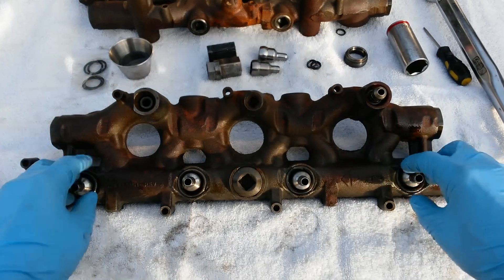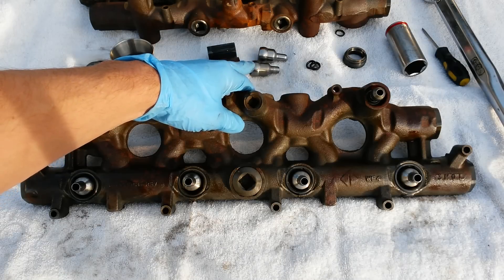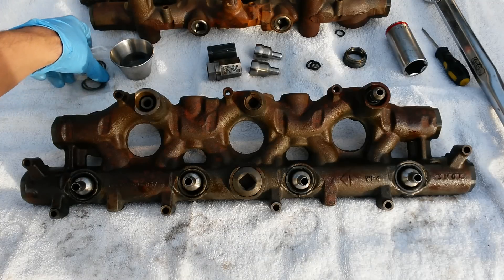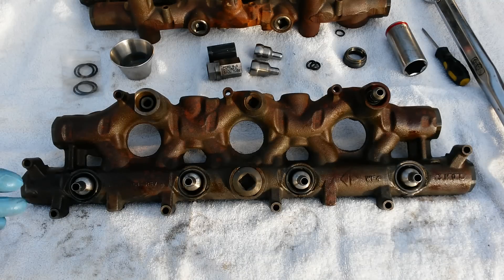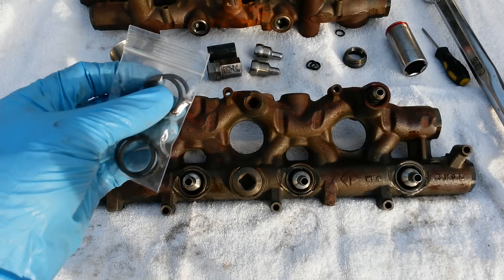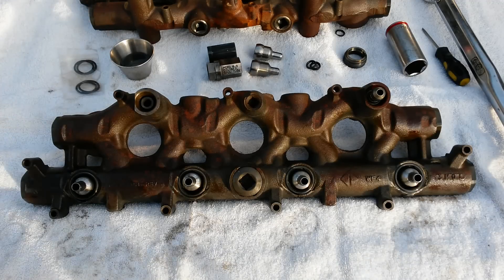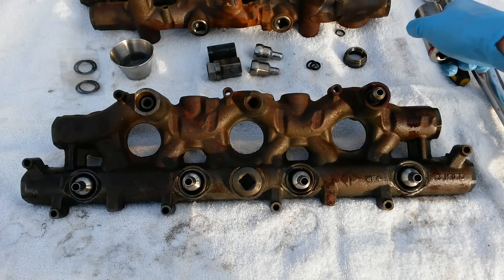We've evaluated that these need to be replaced. You're going to need to decide if you want to go for just the o-rings or o-rings and ball tube kits. If money is no object and you have a time problem, go ahead and get the kit from Boss Tech — it comes with the nipple cup and the o-rings. Most of the ball tubes I'm seeing, even these really bad junkyard ones, are salvageable with a little bit of polishing. I do sell upgraded higher-durometer o-rings on eBay — I'll put a link in the description — and I also sell the tool for getting the lock nut out. You're also going to need a 23 millimeter socket; I got one at AutoZone for seven or eight bucks.